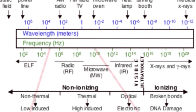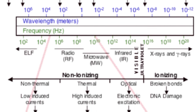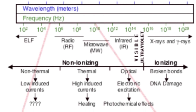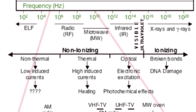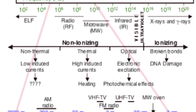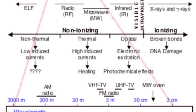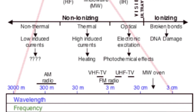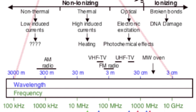Bonus Fact 3. The particular band of microwaves produced by typical microwave ovens, 2.45 GHz, was chosen primarily due to the fact that it is a frequency set aside for non-communication uses. Within the available frequencies that are not set aside for communication, 2.45 GHz was chosen because 433.92 MHz would require expensive equipment to generate sufficient power to heat food; 5.8 GHz and 24.125 GHz would require much higher electricity costs; and 915 MHz was rejected as it wasn't a band available worldwide, as 2.45 GHz was.